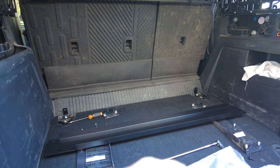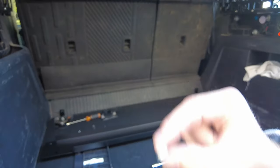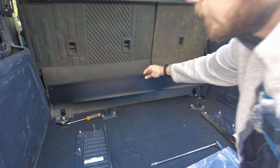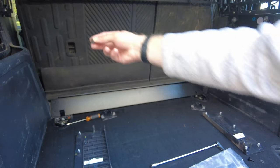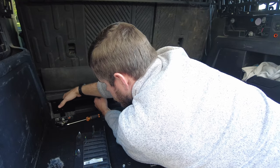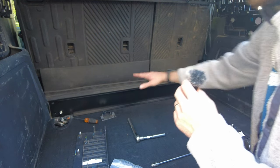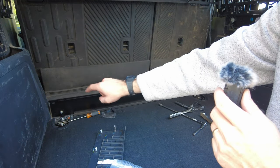Next, we're going to take two carriage bolts, two washers, and two nylock nuts. Take this panel — you'll see it has the shorter section here and the longer section here, and three holes in each side. Place that right here with the shorter section on the bottom, and thread your carriage bolts through from the back into those brackets we just installed. It's important to remember not to snug down these two bolts all the way — keep it a little loose still for final adjustment when we fit everything together. Once you get it in place, center it, make sure it's level with the floor, then tighten the bolts all the way.